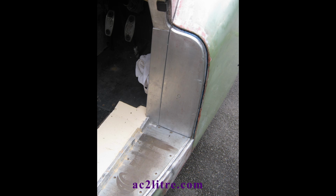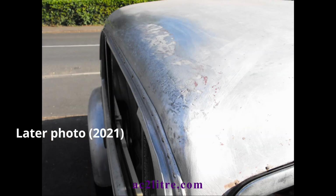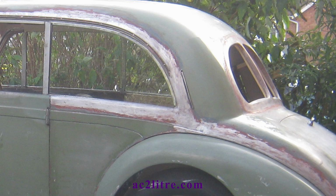Then I had to repair the guttering. As they were originally nailed on, I'd been forced to resort to prising them off back in 1991, as there is no access for tools to pull the nails out. I had to carefully straighten out these gutters, which are made from extruded aluminium, match them to the body curves, and then fitted stainless steel wood screws. I also test fitted the trafficators to make sure that they can line up with the slots.